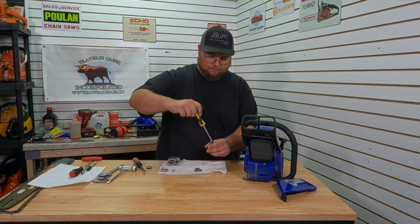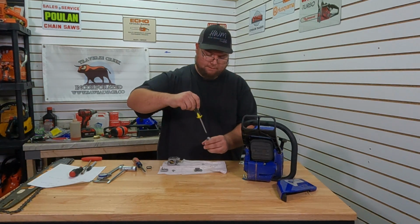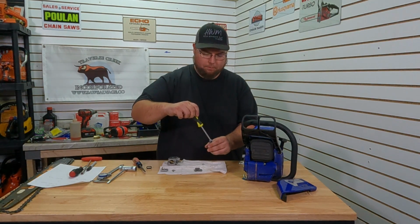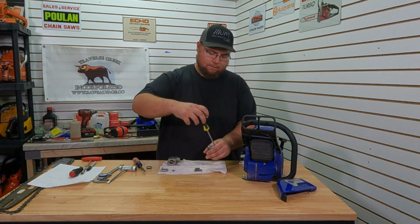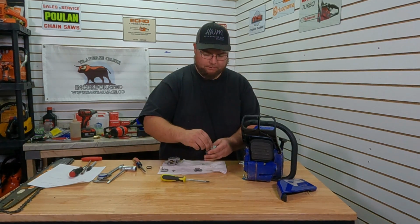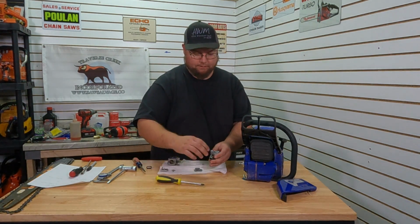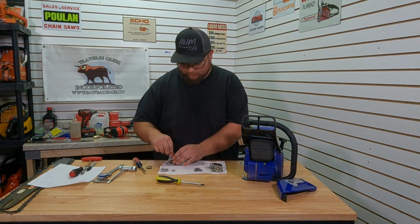But I really want to learn all of the different channels and circuits, the high speed, the low speed, how exactly it affects it. And now to flow the nitro fuel, we do need to open up the ports, open up the holes, but we still need the needles to seal. That's a big thing with getting a nitro carb to work right. Right amount of pressure, right amount of sealing, and the right amount of flow, especially for cold start racing. It's a magic thing when you get everything just right.